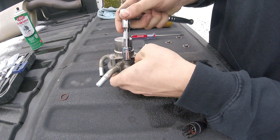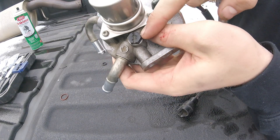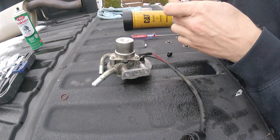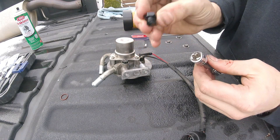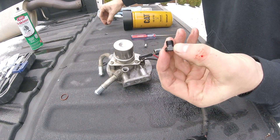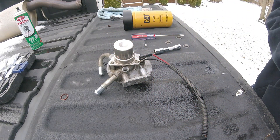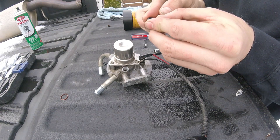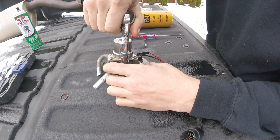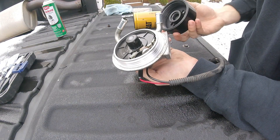The last thing we can do is install the new bleeder screw right here. The old screw is gonna be plastic and it's prone to stripping out — you can see the previous owner has already stripped this one out. So we're gonna take it out and replace it with our new aluminum bleeder screw. The aluminum bleeder screw will come with an o-ring — oil that as well, it just pushes down onto the screw, and then we'll reinstall the screw.